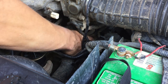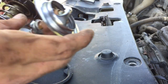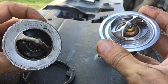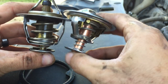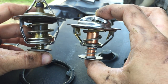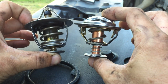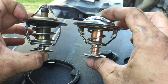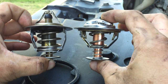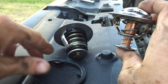Let the floodgates out — that's not good at all. The original thermostat, which I really do think is original Honda — this isn't a Gates, this has to be Honda original — has 256,000-plus miles on it. It's a lot heavier and definitely looks different from the new one. The new one says it's equivalent, and again the brand is called Failsafe; supposedly when it fails it fails open, which sounds really appealing. It should also help me confirm whether the thermostat was my problem. In about two weeks I've got a trip to Yosemite National Park and I would hate for the overheating problem to not be fixed by then, so fingers crossed this does the trick.